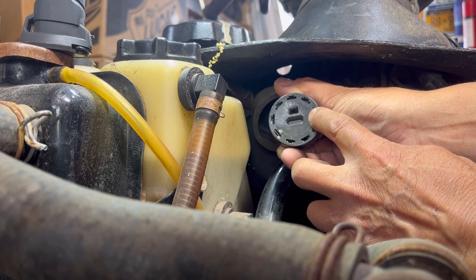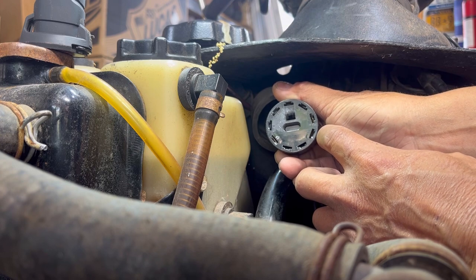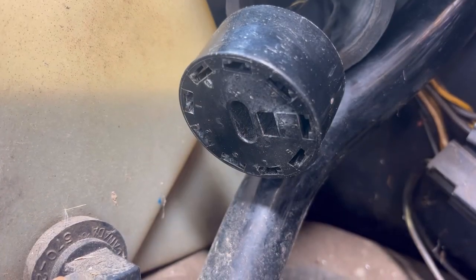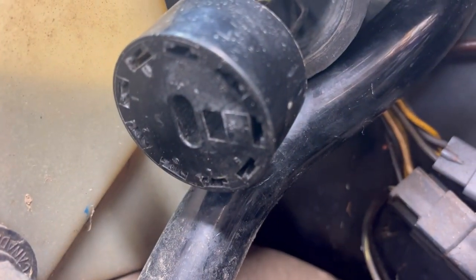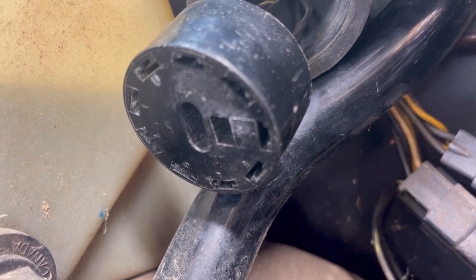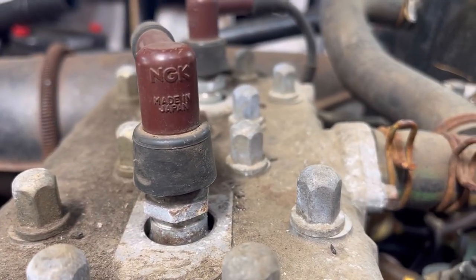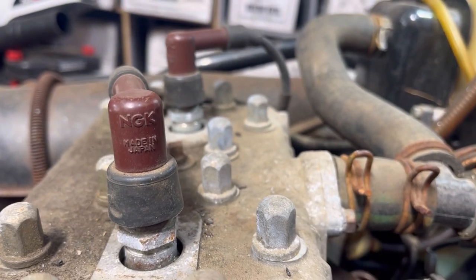It's either connects these two or disconnects these two. If you have it just like that it's disconnected, meaning the ground doesn't touch the magneto, so it'll be okay to run. I think that because these two need to touch for it to shut off, just removing the tumbler makes it a disconnected circuit — magneto now doesn't go anywhere, ground doesn't go anywhere, so magneto is not being grounded. Therefore we should get spark. I'm going to remove the spark plugs and find out.